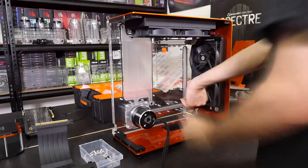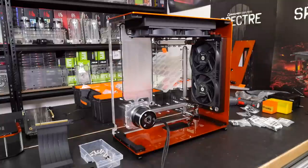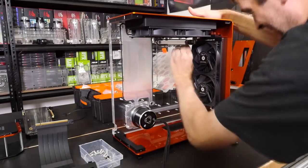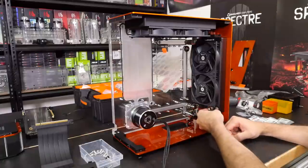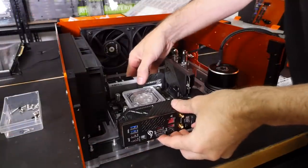So component order is really important. And the best thing is to get the radiators in first, I find, and get those tight connections from the radiators to the distribution plate. And you can see the two closest ones, which I've already done, they just come down to fittings selection. If you get the right fittings, it's going to make your life a lot easier. And I suggest telescopic fittings or D-plugs where you can just push them on.